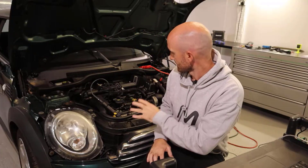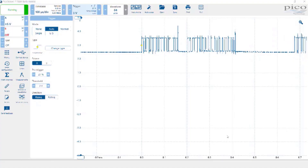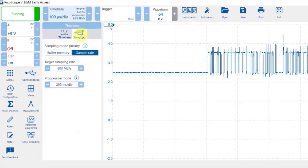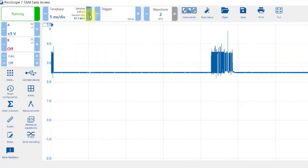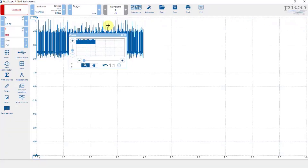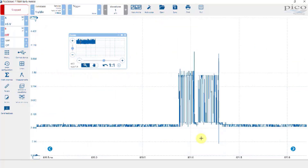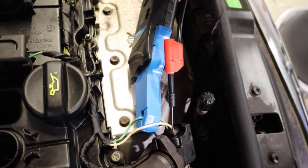I'm just going to show you a couple of things this thing can do. Straight up you can see here that we've got a CAN bus signal - that's a CAN high signal and it's a pretty good signal. If I just show you the power of this thing: I've increased the sample rate to the maximum and increased the time base to a much longer time like one second. What you can do is stop it and then actually zoom in and look at how clear this waveform is - for the price that's just amazing.